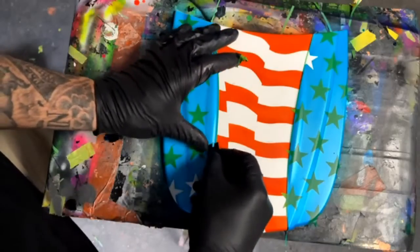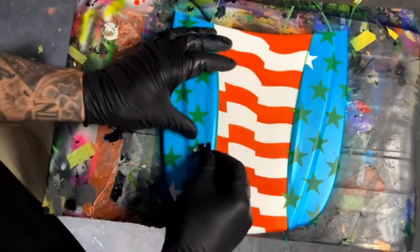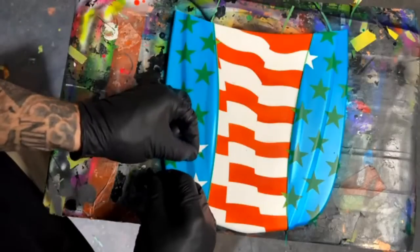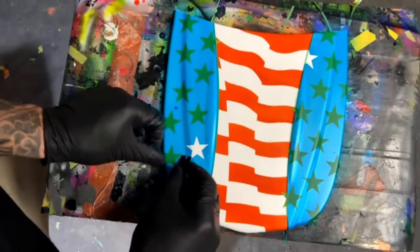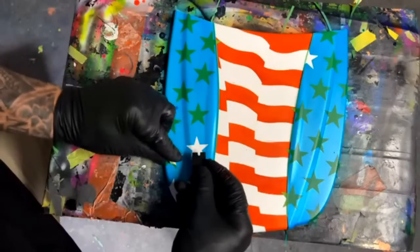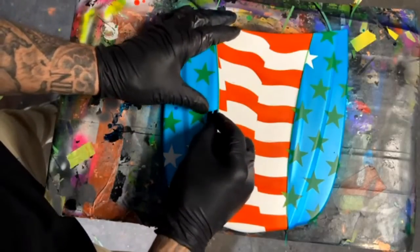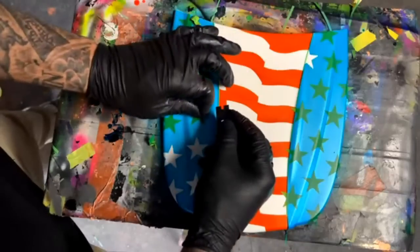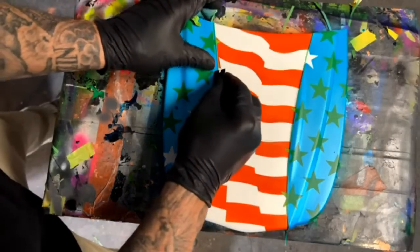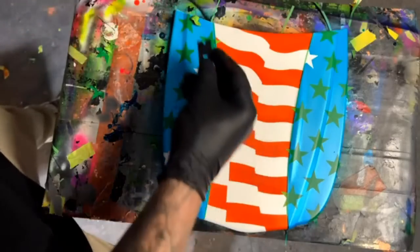But the answer when it comes to paints like this with urethane reducer is, yeah, they usually do have a slow, medium, and fast reducer. Everybody uses different stuff. Some people prefer to use slow. I like to use fast. I really think it doesn't matter a whole lot. If it's really hot where you're at, say you're in Arizona, you're going to want to use slow reducer, because it's going to flash off so fast. It could dry before it even hits the panel, and you still want it wetter than that. But if you're in cold conditions, then you would use a fast reducer. If you're in between, I would just stick with a fast or medium reducer. I use medium here all the time. That's what the lime line is.